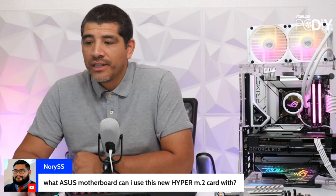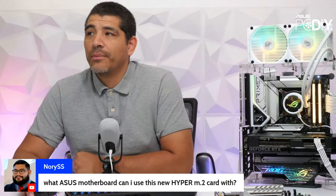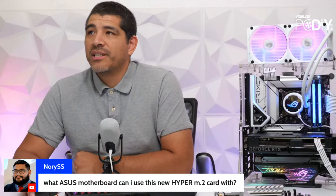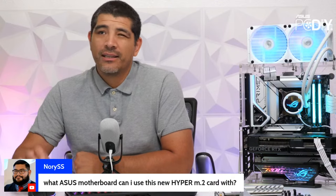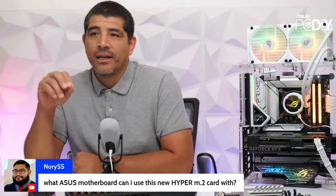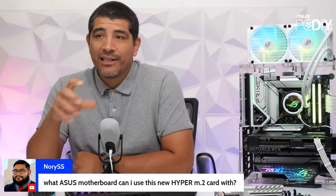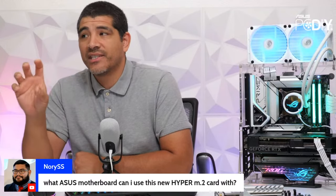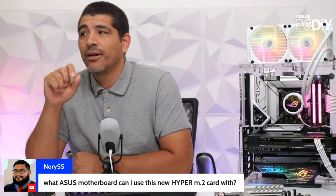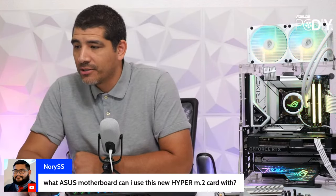Nori asks, what ASUS motherboard can I use with the Hyper M.2? So that's what I was noting, you would just want to check the PCIe bifurcation list that we'll have. That is noted there, where you can bring it up in the tech spec information and in the QVL information on the website. But again, the main thing you want to check for is that the motherboard supports PCIe bifurcation. And then critically, if you're not using the primary slot, so if you're going to use some sort of secondary slot, that secondary slot also has to be wired for PCIe Gen 5 specification support, right?